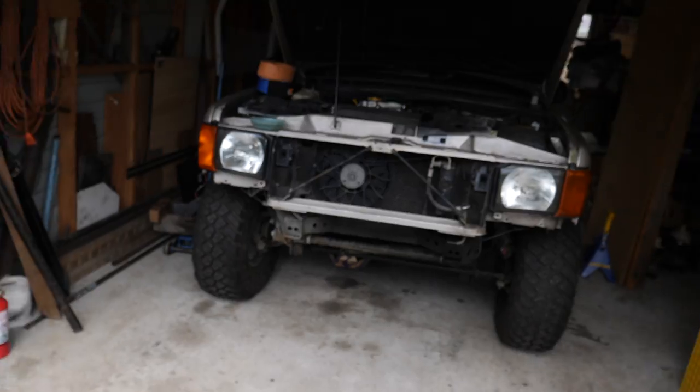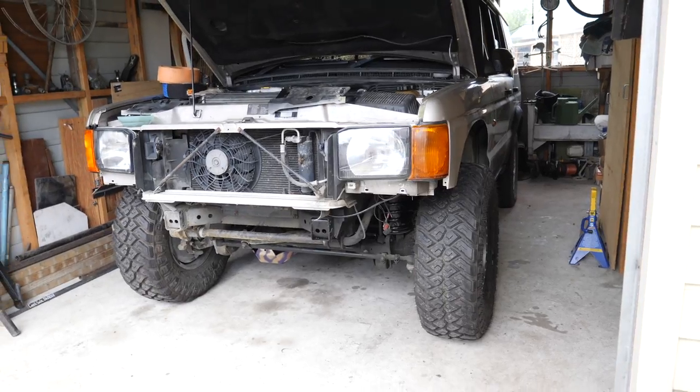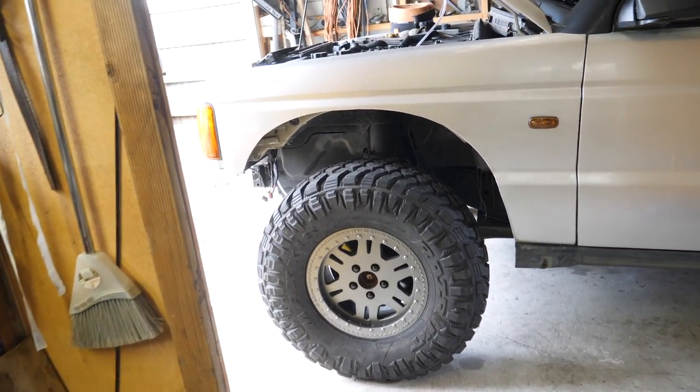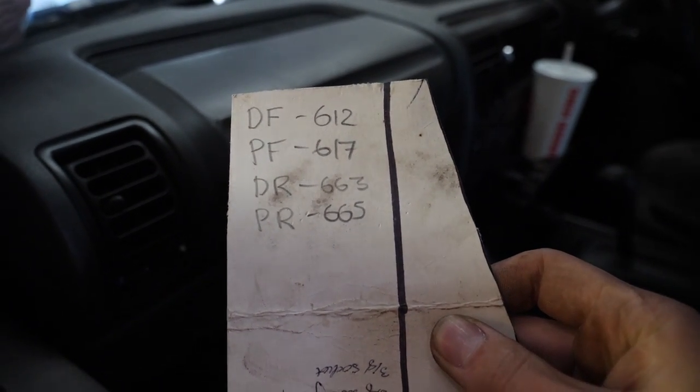The bump stop then compresses quite a bit. They're quite conical, rubber bump stops rather than a hard block, so you do actually have some sort of squish before they completely top out. Anyway, that's looking really good. Looks a lot better sitting nice and high as well. Well, not nice and high, I don't like high trucks, but a reasonable height. It definitely was a little bit too much of a low rider before. Yeah, as you can see, that looks awesome. Righto, passenger front 617 to 665, so we've gone up what's that, 48 millimeters,